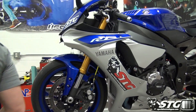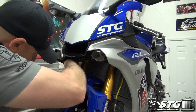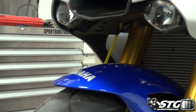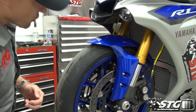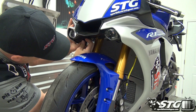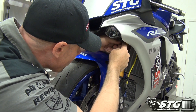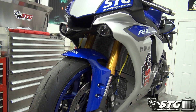The trim underneath is held on by these push pins — two-piece. You push in the center to release it, and then pull it out like so. To reinstall it, you push it back through, slide it in, and push that back until it's flush once again. I've got a handful of these up in here that we'll need to remove. That will give us the necessary access to get in there and replace our steering adapter.